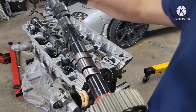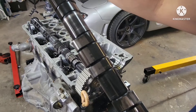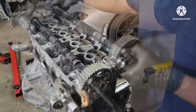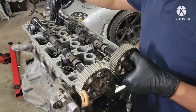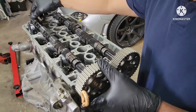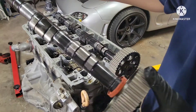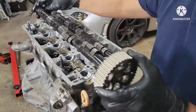All right, you can see here — right there, look at that — spring is out on that cam seal. That's why it's leaking. Let's quickly show you guys how bad these markings are, especially here. I don't know if this is any good. It will be the center caps right here — is the one that got no oil, not much oil. And this one is okay, cam seal's spring is okay, but look at those markings. My god, that is not good.